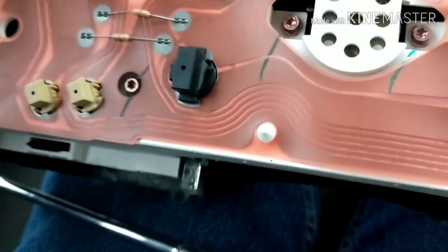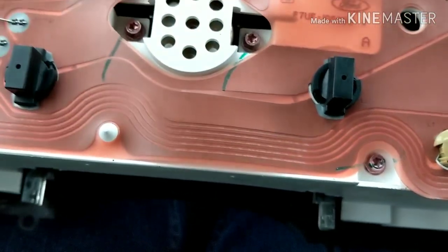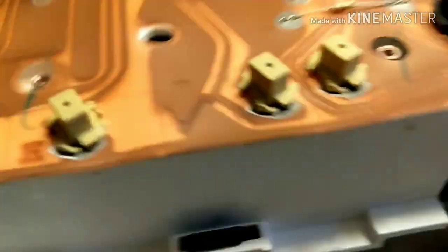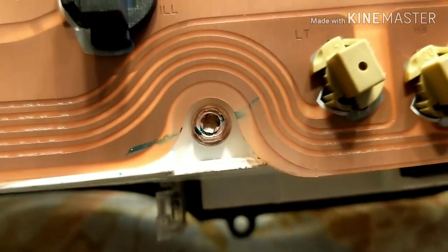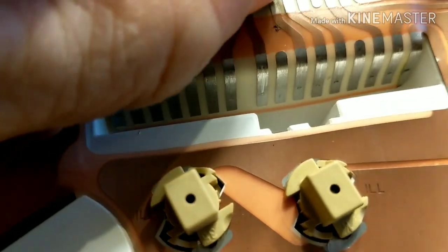So it's raining outside, I'm going to go inside and take this thing apart. Basically we got to get behind the motor right here — this is what we're trying to do. I got to take everything off of here. There are a couple screws in here — these are T15s — and I need to separate this from the back side. There's one there, one right there, one there, two here, and there. And then on the top here we have the ribbon that we have to take off — there are two little tabs on the side I'm going to pull out, then pull that clip out.